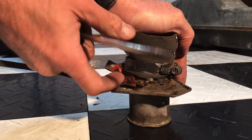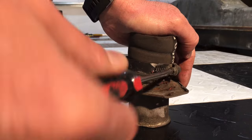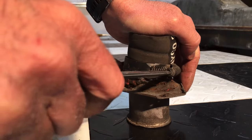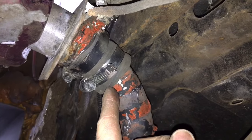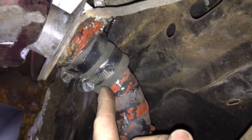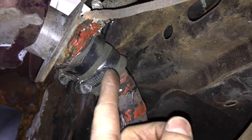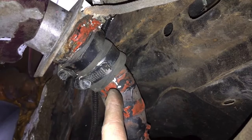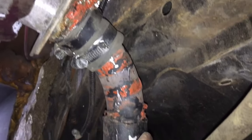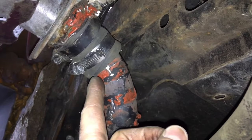I have the length of hose attached here, and we have one hose clamp here. We're going to go ahead and tighten it, and then we'll attach it to the actual neck. Went ahead, connected this into the fuel filler hose right here, and then we tighten this hose clamp so that we have this coming through probably right about here where it connects in, and then this is really just sealing that together. I don't know why they had that whole thing coming all the way down to here, but whatever it was failing. So we have all this in, just a simple connection like that.